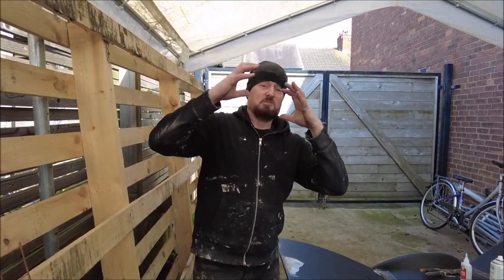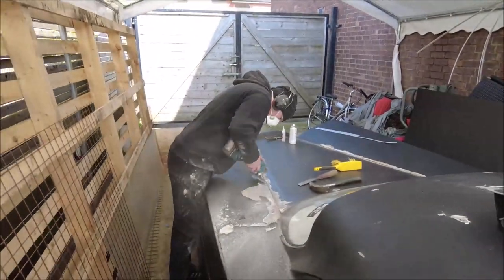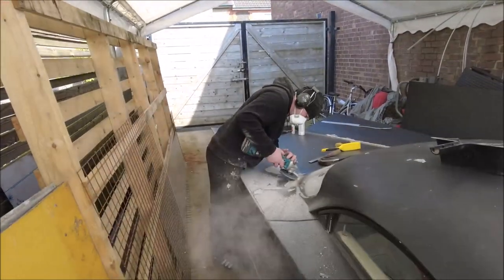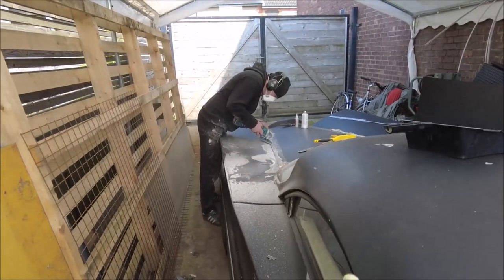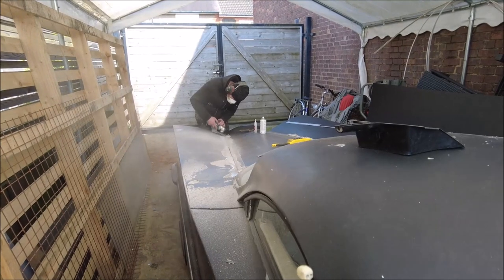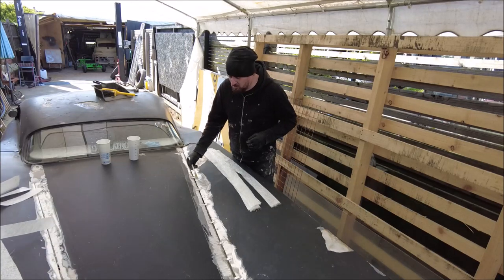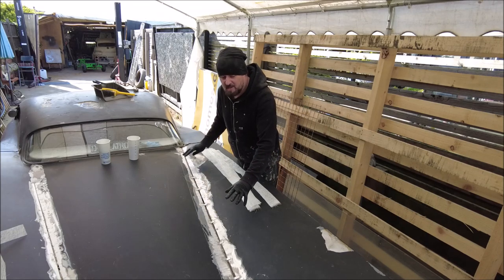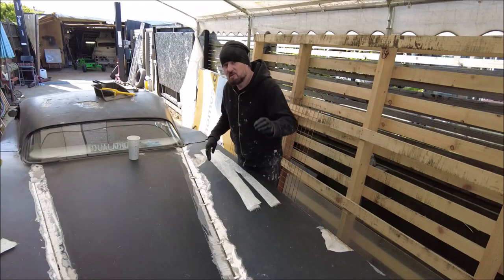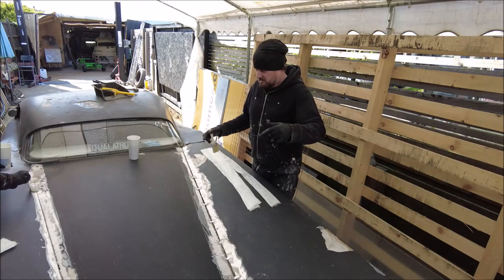Because it goes like that, it provides triangulation in the boot — trunk — structure. Let's get that ground up. So then, we're going to glass these in. First thing we're going to do, we're going to really work the resin into all of this, just to stick everything together and make sure we get great adhesion on these two joints. Once this is dry, this will be back to being a nice rigid panel again. But don't forget, we're going to go over this whole area in fibreglass just to make sure it's bulletproof and future-proof. Let's get to the resin.